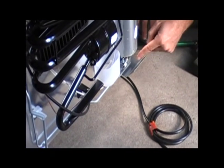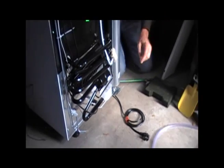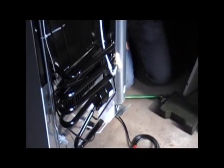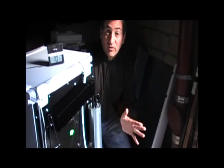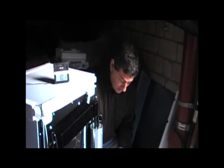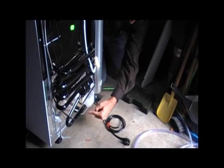This is where the propane would go into the chimney, and that's where the automatic spark device is — it would light it and then heat this up. But all you really want to do is just heat this chimney. How you heat it is completely irrelevant. If you get it up to the right temperature, the refrigerator is going to work. That's why we just put our biogas right in where normally the propane would go.